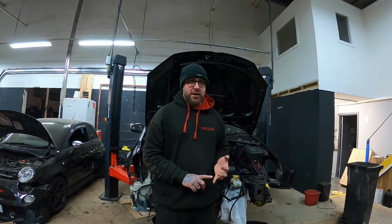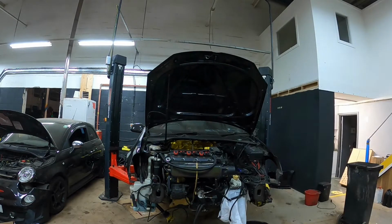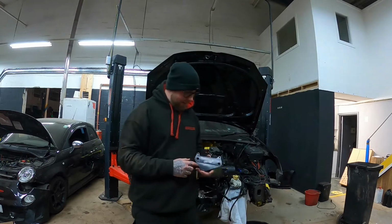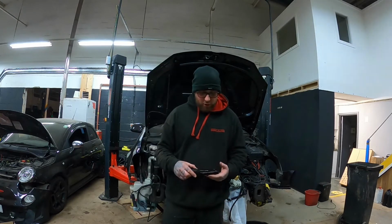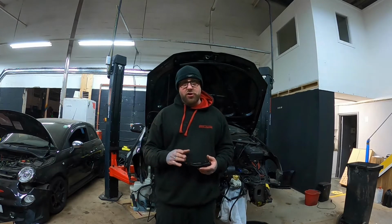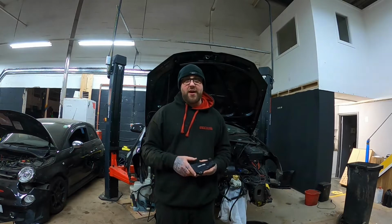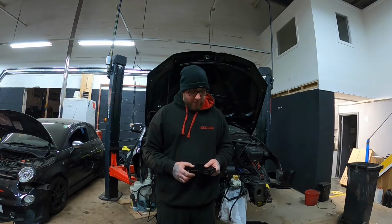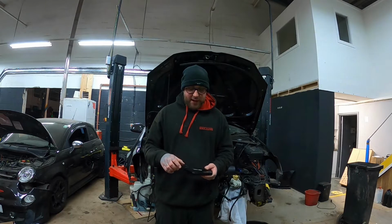So when I originally built the engine, what I did was, let me get it. I did this type one. So this plate, I won't bring you over there, it's pretty self-explanatory. If you look on the top of your DQ250, your 02E DSG gearbox, and a lot of the other ones, they're very similar, the DQ500, DQ381, they have a heat exchanger that goes straight on the top. So basically there's two O-rings straight on top of the box, 3 bolts, this clamps down.